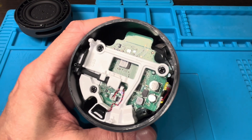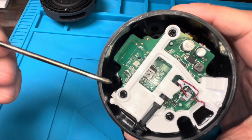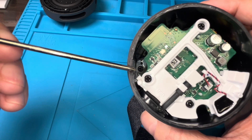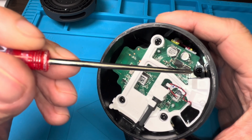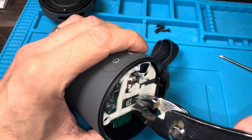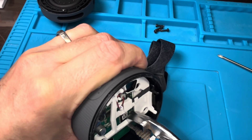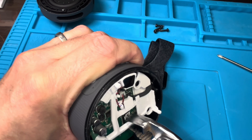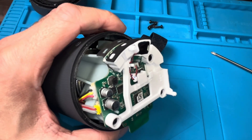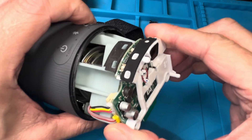Now let's have a look inside — we have a PCB, a couple of screws, a plastic bracket, and when we look really deep down we're going to see four more small Phillips screws right down there. We're going to remove those four screws, and it's really helpful if you have a magnetic screwdriver for this. Then I'm going to use some pliers to pull out the entire assembly, which takes a little bit of effort.